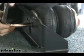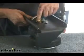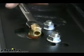At this point you want to double check your torque ratings and check your bolts too. Next we're going to install our little angle brass part here, kind of like an angle pipe. We're going to run it down to where the sealant goes into the threads on the airbag itself. We're going to go ahead and use a half inch wrench just to tighten it up. Looks like we're good to go there.